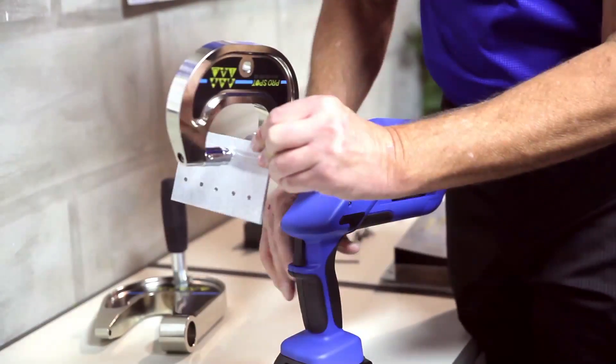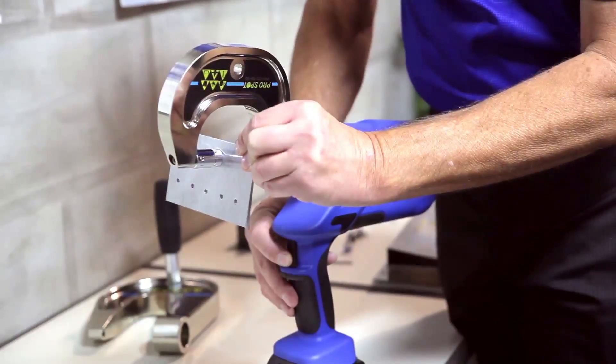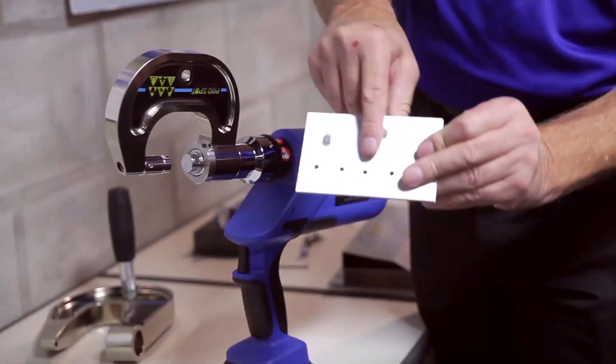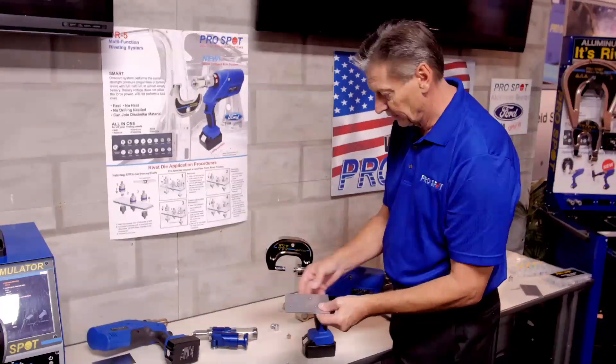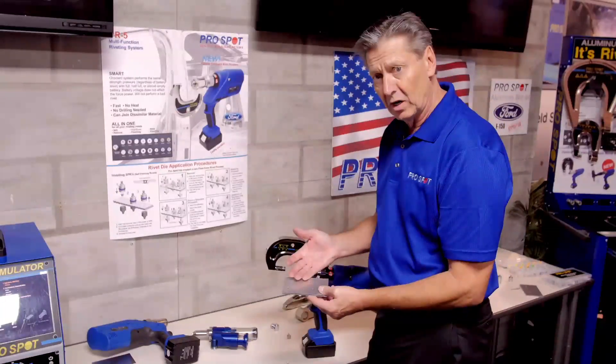All we need to do is install these, and as I apply pressure we flatten out the surface perfectly flat. With this high pressure gun and the flattening tips you now have a nice and even surface, ready for the calibration punch if you want to install flow form rivets or solid rivets.